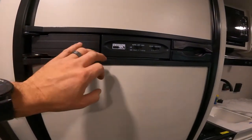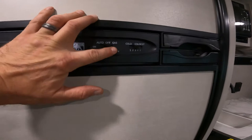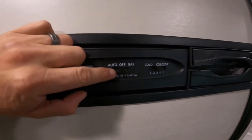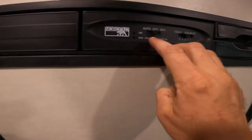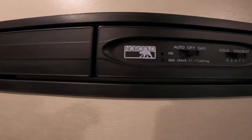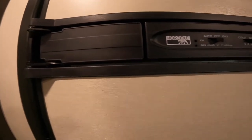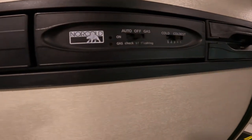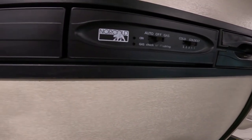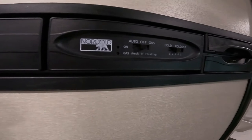The refrigerator works on gas and electric. When set to gas, it will only attempt to draw from gas. When set to auto, it will attempt to draw from electric first; if it's unable to do so, it will then attempt gas. When lighting on gas, if you see this light flashing, that would indicate it did not light properly — often it can be a supply issue. In that case, turn this off to the off position, check the bottles out front and make sure the valves are open fully, then come back in after a minute and try to light again. Often it's just a lack of pressure built up in the system — not adequate enough to light the appliance the first time.